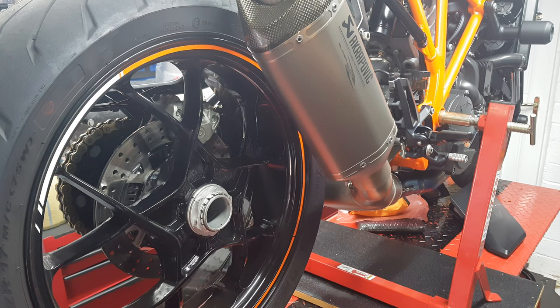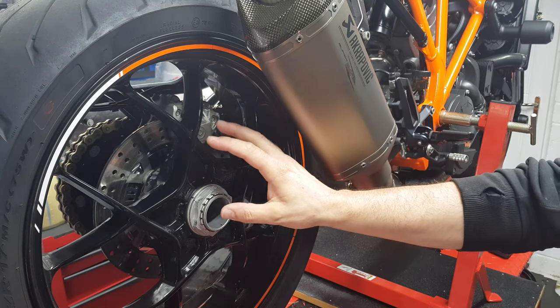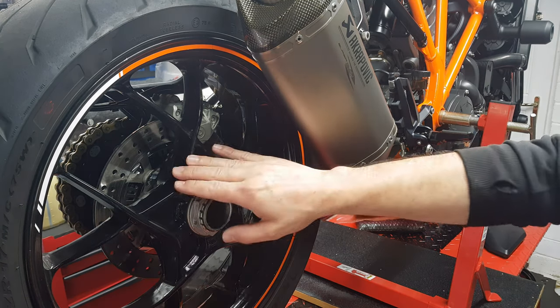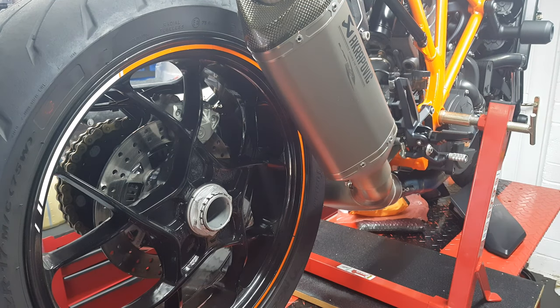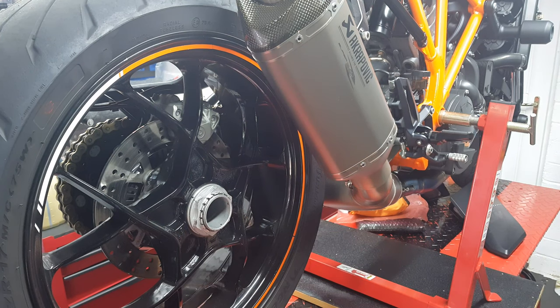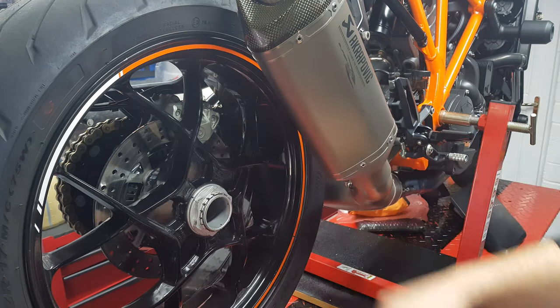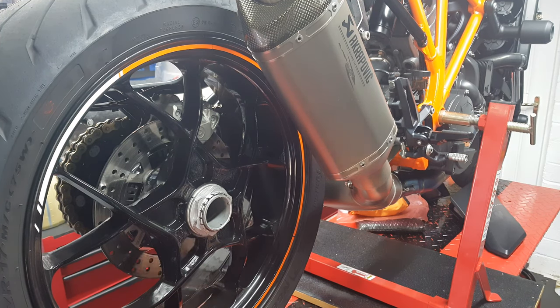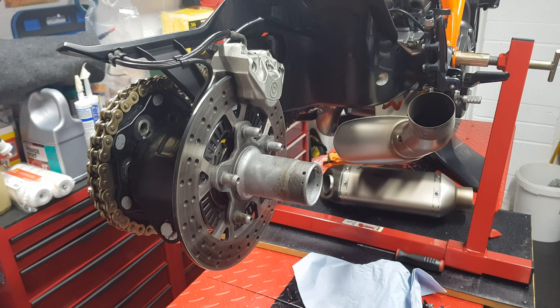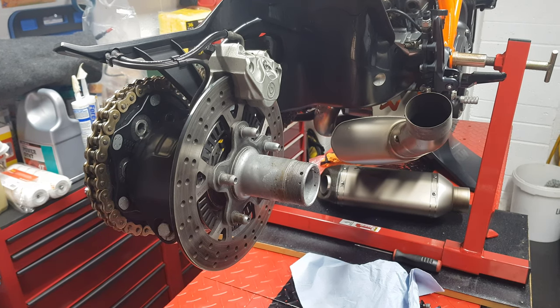Back of the garage, and what we're going to do this time is attempt to strip down the rear wheel hub and change the bearings. First thing to do is remove the rear wheel and a bit of the exhaust end can — there are loads of videos on how to do that. Just make sure you've got someone to loosen both sides: this side is the 60mm nut and the other side is a 41mm socket.